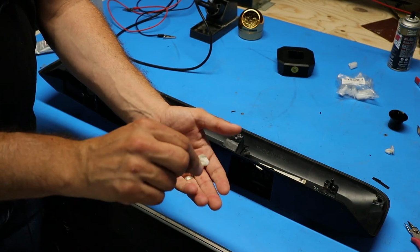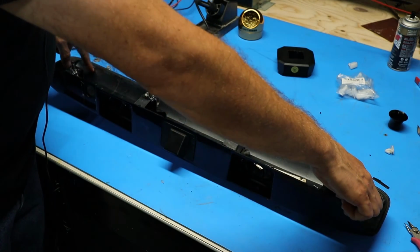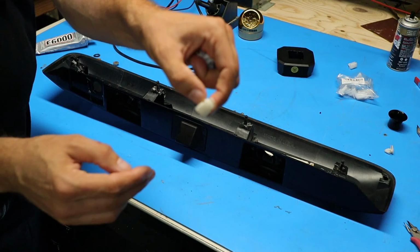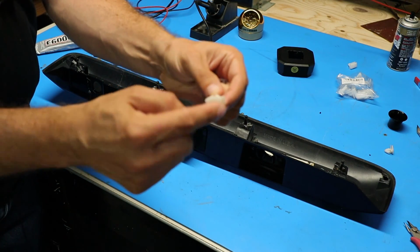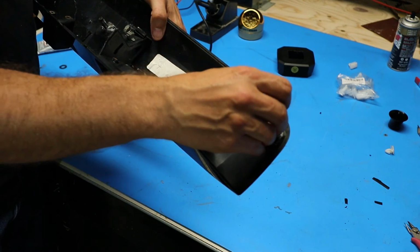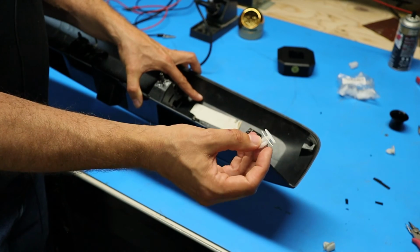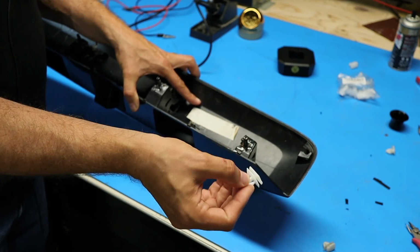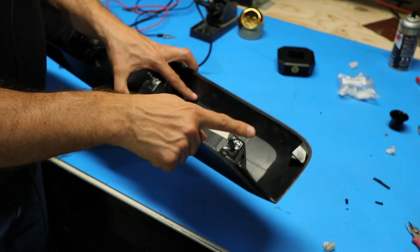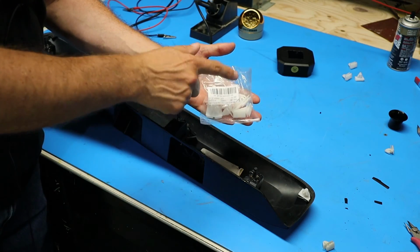The first thing that I wanted to do is find replacements for these two side clips that go on either end of this trim panel. Now, you guys may remember from earlier parts of the video that these sort of have a rounded edge on them. And that's so that when they clip into place on the trim, they clear the radius here. So I couldn't find any replacement clips with round corners, so I just bought some rectangular ones and clipped off one of the corners. They should fit just fine on there. I ended up getting these on Amazon, so I'll leave a link below in case you need some of these for your project.